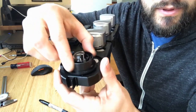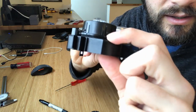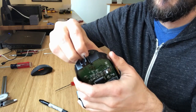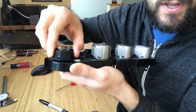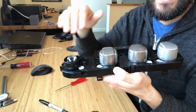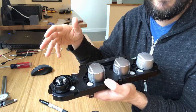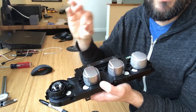Once you get three tabs, the fourth tends to go and it comes off pretty easily. When this thing pops off, it pops off from this ring right here, and this ring has gear teeth that mesh with the white gear underneath. If you're not careful or use too much force, the white gear will come right off — I know because it's happened to me. If that happens you'll lose your engagement with the white gear, and if you don't put it back exactly as it was from the factory, your controls are not going to function properly. The only way to fix that is trial and error.